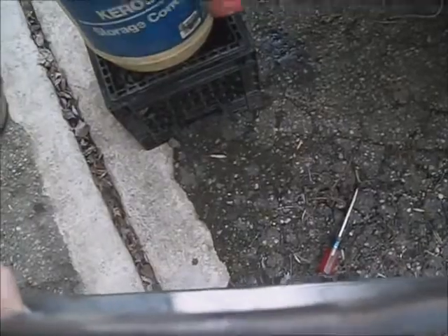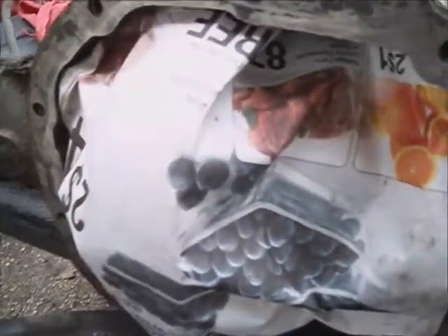Check your cover for any deformations — that flange should be flat — and for any rust hole scabs. This one is just a little bit scabbed up; you can scrape all that off and paint it if you want. Make sure there are no little rust scabs inside. If there are, you'll need a new cover — any little imperfection of rust inside is a problem. You'll be putting another rear end in after it goes through it. I've got that all cleaned up; now I just have to clean this face off and get all those pieces out of the holes.